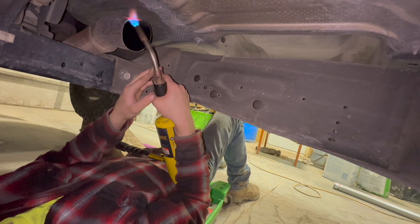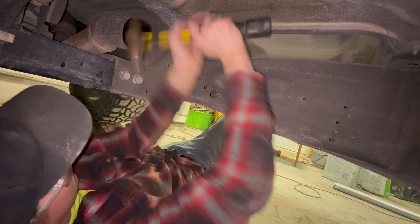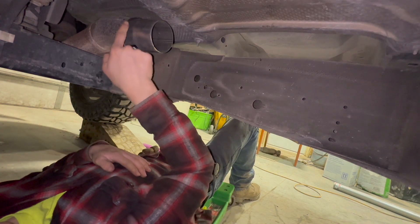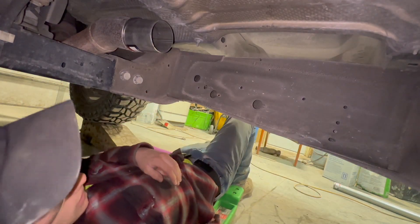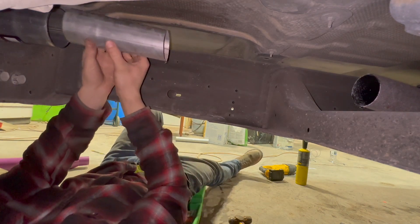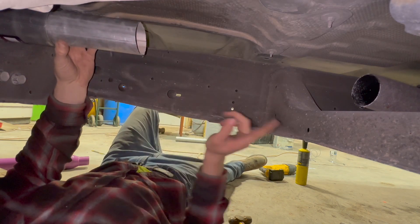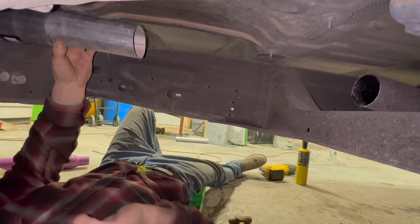Now we're getting somewhere. I'm a professional exhaust guy now. We're just gonna try to weld that gap up the best we can. I'm gonna put all this in there loosely to make sure it fits first. So basically we're making another reducer — going from a 3-inch OD to a 3-inch ID to a 2.5-inch OD to a 2.5-inch ID — just reducing it down to two and a half so we can put the glass pack on. I'll weld all this up, then cut wherever I need to, put the glass pack in there, and weld it all up.